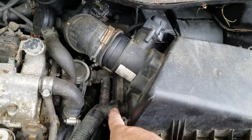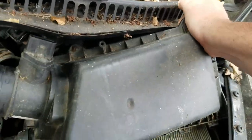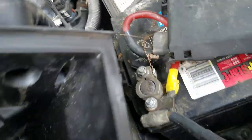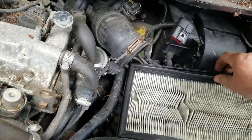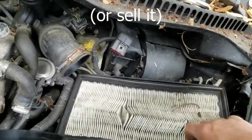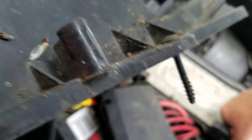Alright, let's get this pulled off. Watch you don't have any metal touching the positive post — we'd be able to arc it. I don't recommend putting your car outside for storage. Just figure out a way to keep driving it, because once you start parking stuff and leaving it set for months and months, stuff starts going bad on it. Brake calipers start locking up, reverse light switches keep hanging on.